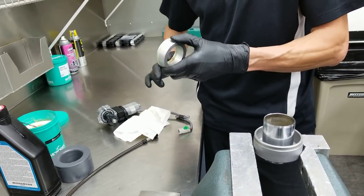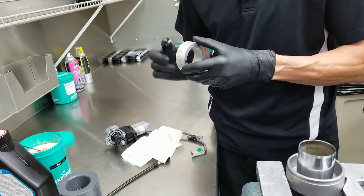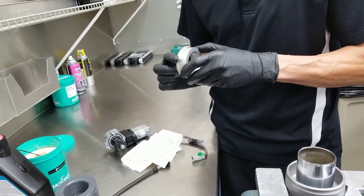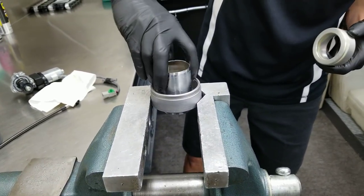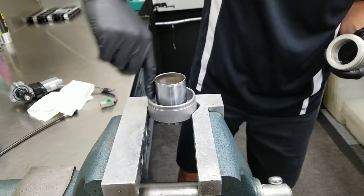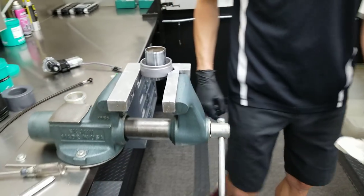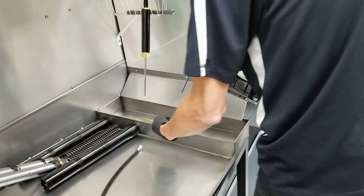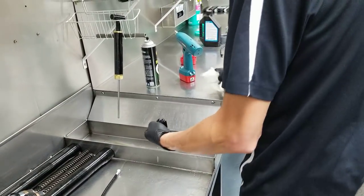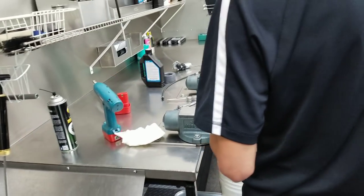Well, I'll use a light grease on the O-rings. There's an inner and an outer as it slides on the surface, two surfaces it moves against. There is a nice supplied chamfer on it so that it won't damage the O-ring as you put it on the sleeve that it slides on. Can't be too clean.